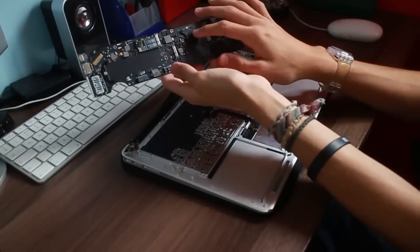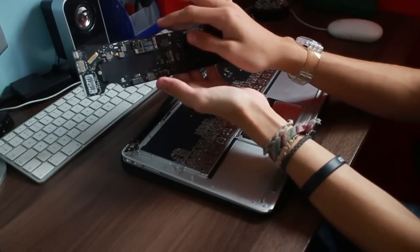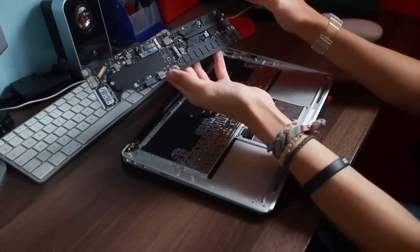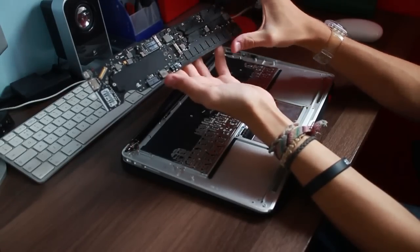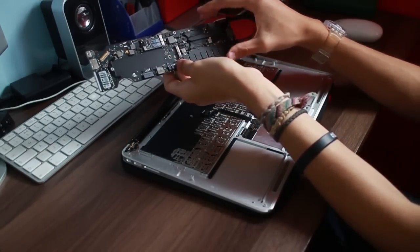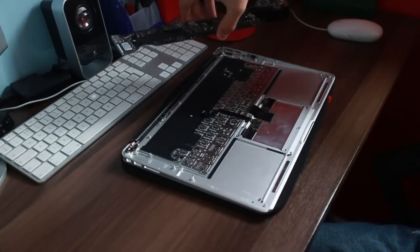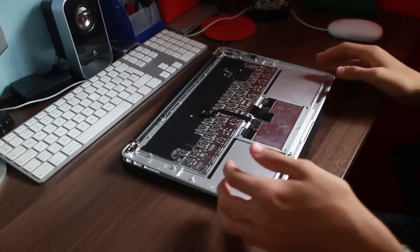This has the 2.13 GHz Intel Core 2 Duo, AirPort Bluetooth, of course, 802.11n, two USB 2.0s, mini DisplayPort, MagSafe, and headphone jack. It has the GeForce 320M with 256 megs of VRAM, which is a really nice little chip, and better than some of the integrated graphics that came in them afterwards, like the 3000, 4000 Intel graphics. But yeah, that is a MacBook Air. It is just unbelievable. It's insane. So keep that very, very safe, of course, because you ain't going anywhere without a logic board.